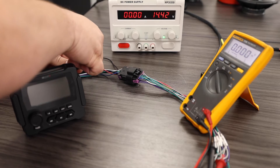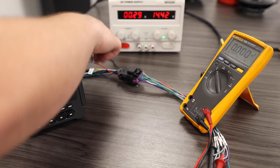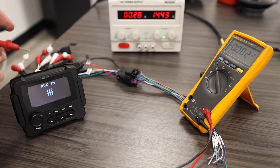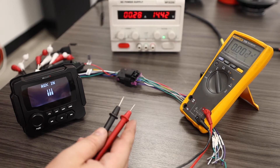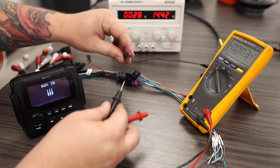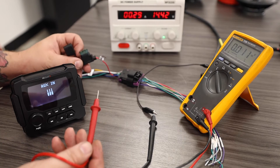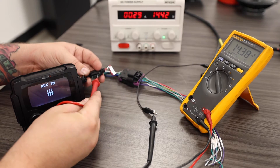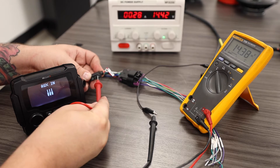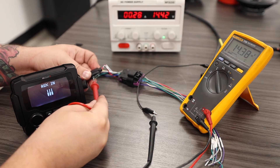One way is to look at the fuse and see if the contact is still intact. Another way is to use our digital multimeter. I'm going to connect a ground strap from my negative battery terminal to my common lead of my digital multimeter. Now I'm going to take my positive probe and touch the metal tab on the top of my fuse. On my supply side or battery side, I'm reading 14 volts. If I go to my other side, I'm also reading 14 volts.